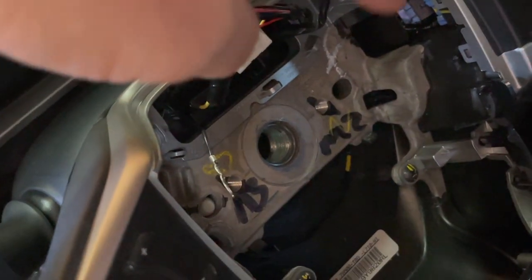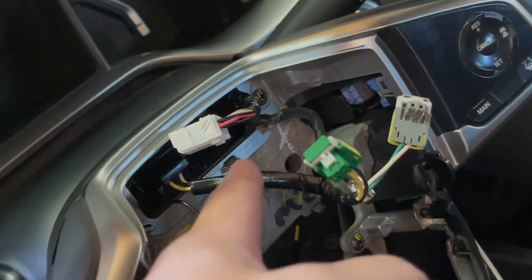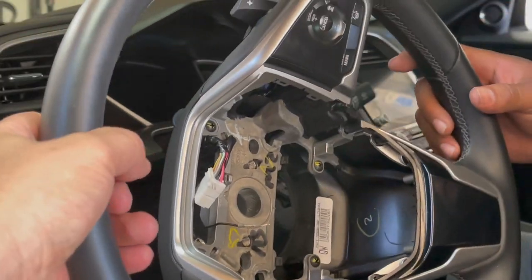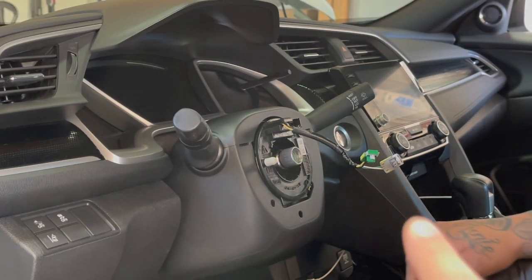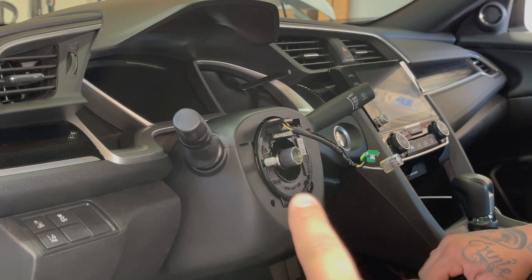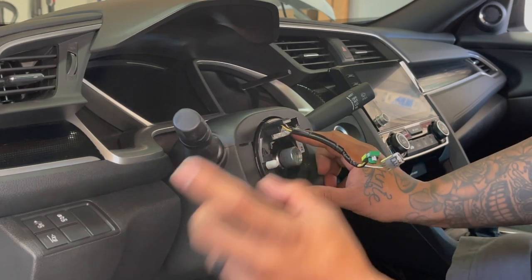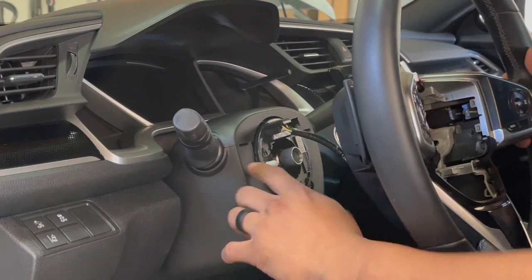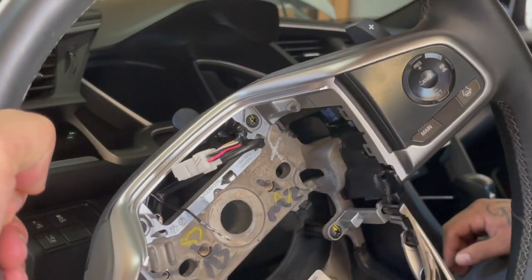All out. That ground wire we were talking about goes right in there, and now we're going to make sure that all these cables and whatnot don't get pinched when we pull out the steering wheel. We got the steering wheel removed. If it doesn't come out smoothly, the tip is to bang it on either side just with your palms — bang it, bang it, bang — and then it should slide right out. This is also key when you reinstall: make sure this is straight with your plug-in straight at noon, and you got your nine o'clock bolt here which should mount directly in the back of the steering wheel. This bolt should go directly into there to line it up dead straight. Take note of that because I don't want you guys running down the road with a crooked steering wheel.